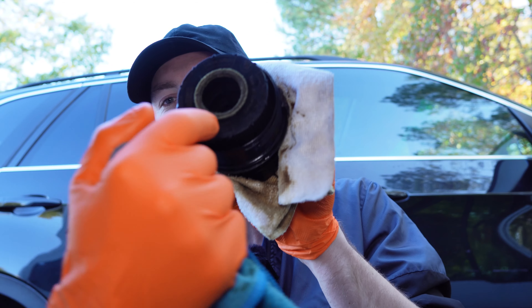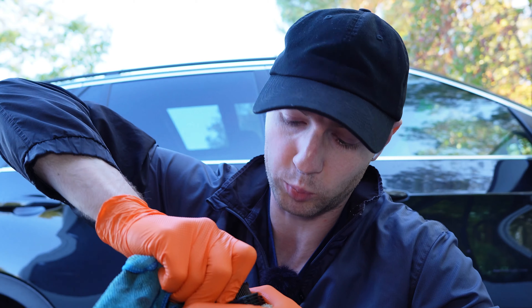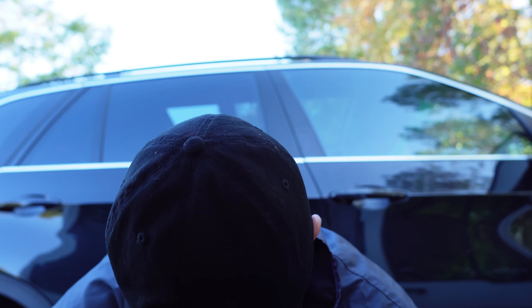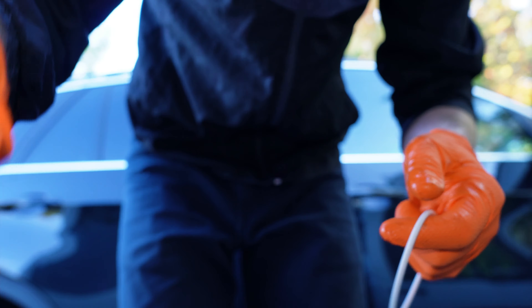I like what I see, and especially the oil filter — it's a BMW unit. For the replacement, we need to replace the O-ring at the base and pull the filter, which is clipped inside with some type of clamps at the bottom. Just pull it out. The new one is Made in Germany and comes with a gasket and everything. We also have a washer — keep that one and install it onto the drain plug. I like to put a little lubrication from inside the filter and lube up the seal. Simply press it into the groove and make sure it's seated properly.